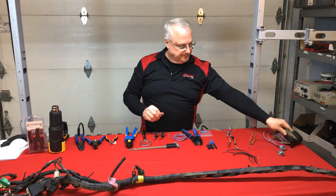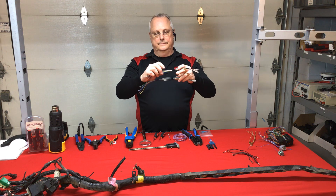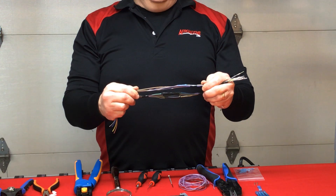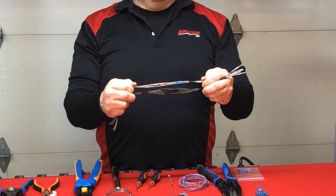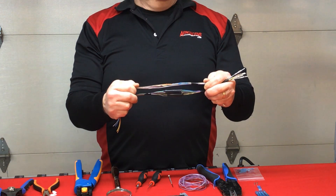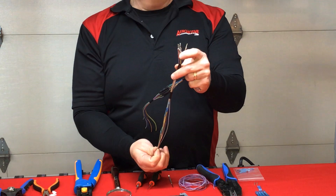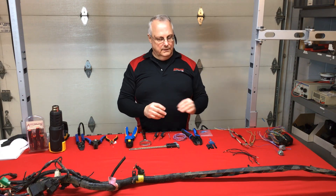On the six wire rule, when we have a bundle or stack, we stagger. Look at the stagger compared to the bundle. The use of mini splices really helps — once this gets closed up it will be difficult to determine whether it's been repaired. Cosmetically it's going to look great, and as a repair, even better. We can always provide you the wire leads necessary to make that stagger.